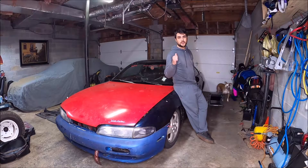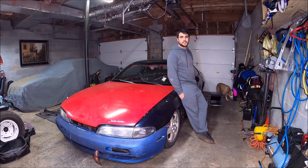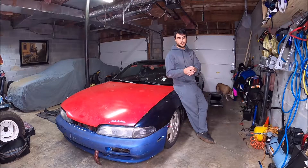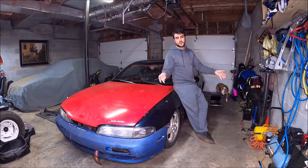The driver's side rear wheel bearing is out, so we're going to pull that off so we can service it and see how difficult it's going to be. I got just the bearing, so we'll have to get the spindle - or I guess the hub assembly - pressed out of the bearing. I call the inside part the spindle; you might have another name for it.